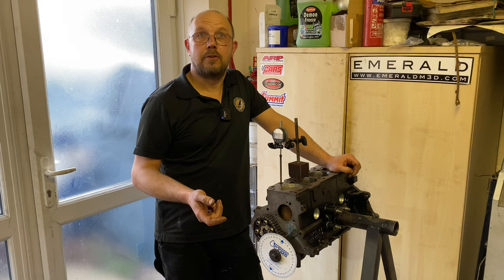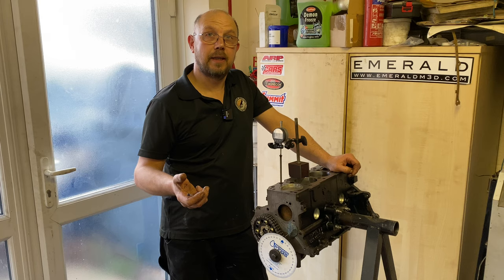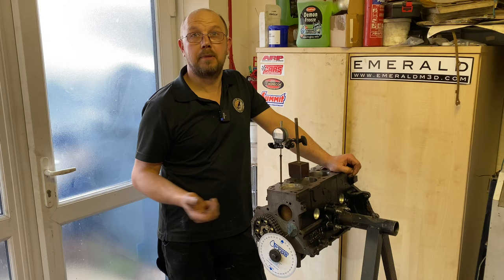The cam is a 234 — a great road-going profile, reasonably racy. In a lightweight car it's quite a tractable road-going cam, but it's also got enough lift and duration that the engine will be happily buzzing around at 7,000 rpm on a racetrack.